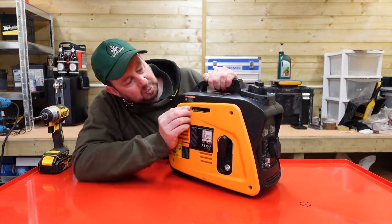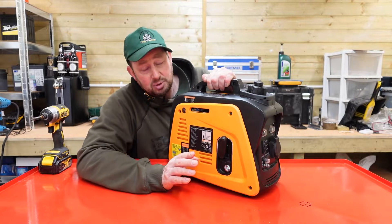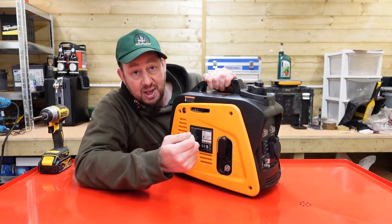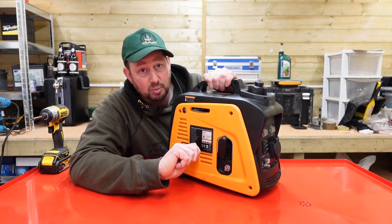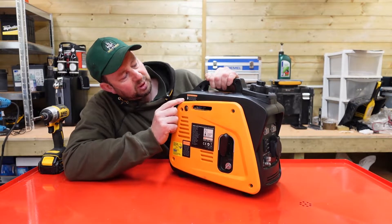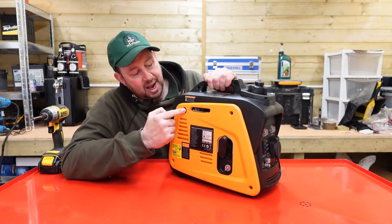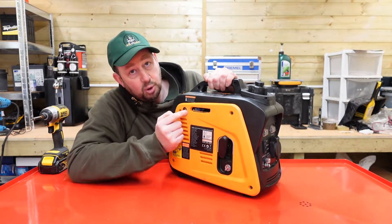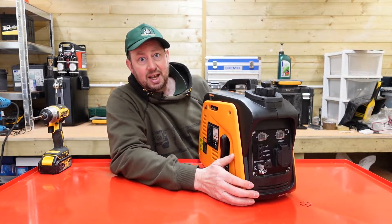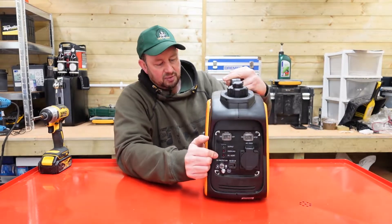Next, to start it, we have to put it round onto choke. This little thing down here — I really forget about it so many times and we're pulling and pulling and it won't go. Turn the fuel to on, so that allows the fuel to come through. That's a physical tap like you have at home and in the off position nothing will come through, not even a dribble. You need it on full, and then we've got a primer bulb. The primer bulb clearly states on the top: pump up to six times. So we'll give that a few pumps. If you ever push it in and it sticks, that's because the fuel is off and you've caused a little vacuum between the two — let go and it pops out. So: primed up, on choke, fuel's on, it's on run, eco's off — now I should be able to start it.